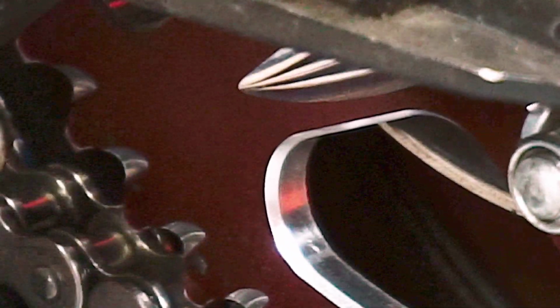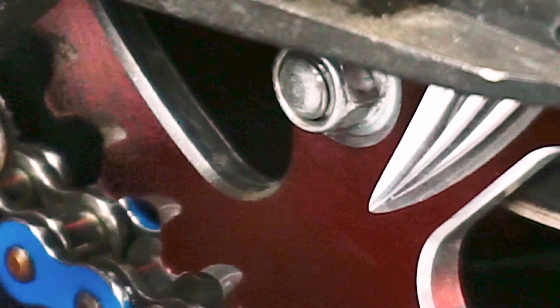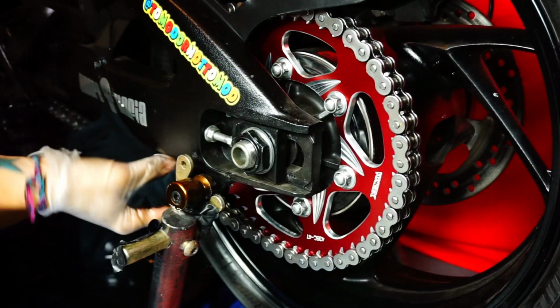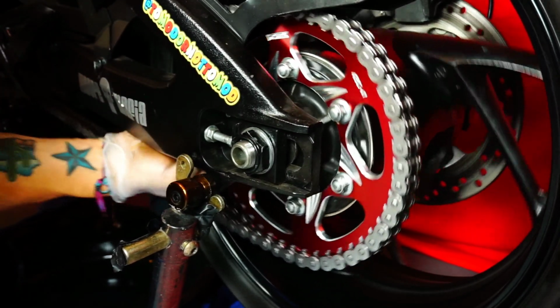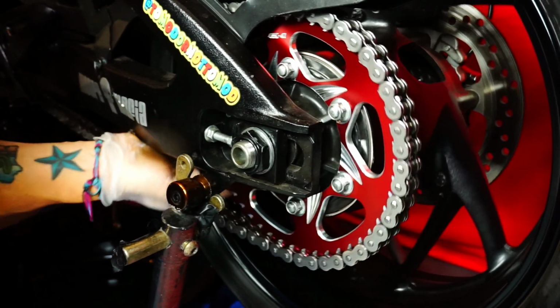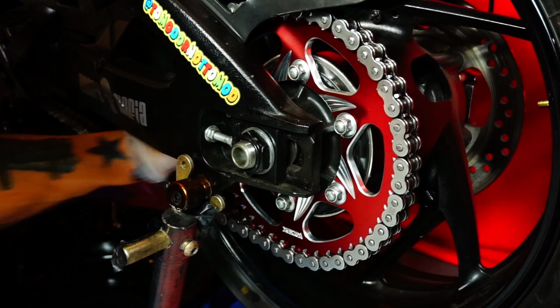It's very important, because if you don't do that, then the dirt on the sprocket is going to end up on the chain. So you're better off just having both clean, and that way the chain's going to stay cleaner the longest. It's also very important not to forget that you have two faces for each of these elements. So on the chain you have 4 different faces: top, the 2 sides, and then the bottom. And then on the sprocket you want to clean the outside as well as the inside.